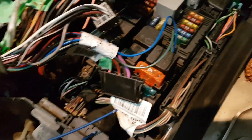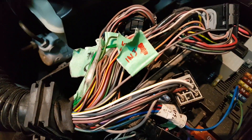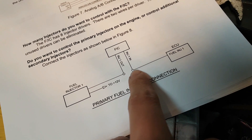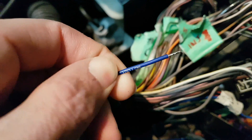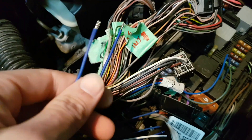Most of the wires were in the two bigger connectors that connect to the ECU. Only one wire I'm taking from the other connector — the wire for the ignition that's going to power the FIC. As an example, here's what I'm doing with the connections for injector one. This is the diagram I'm following: fuel injector wire from ECU. I have to cut the wire in the middle, connect the injector-in wire from the FIC to the ECU side, and the injector-out wire to the side going to the fuel injector. So this is injector one out going to the injector side, and injector one in going to the connector side — and I'm going to cut it from the middle and then make the connections.